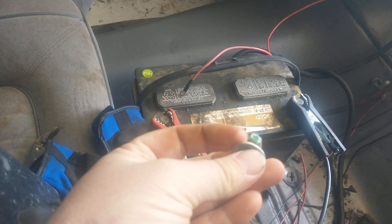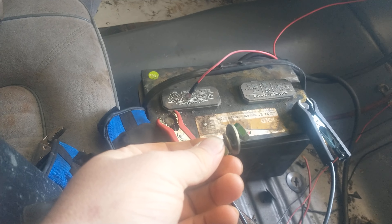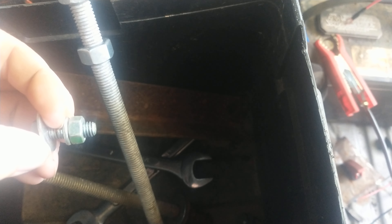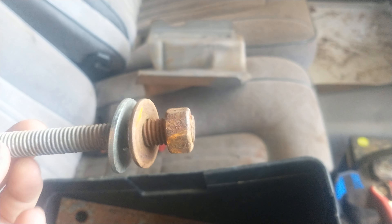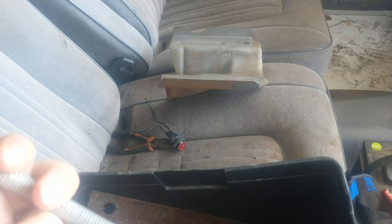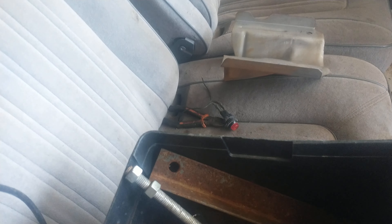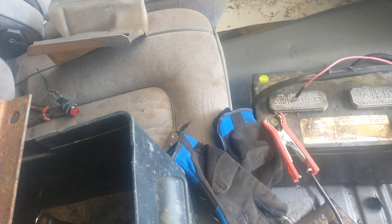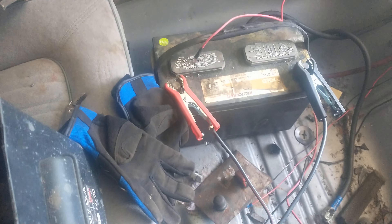How I mount my battery is with half-inch bolts — one in each corner. Since it's plastic, I usually have a washer underneath the metal, suck everything through all-thread. Washer underneath, washer on top, sandwich the floor together, then up top. The bar and angle iron sits like that and holds it in. I've run it that way for the last five or six years with no issues.